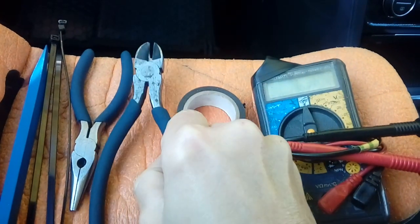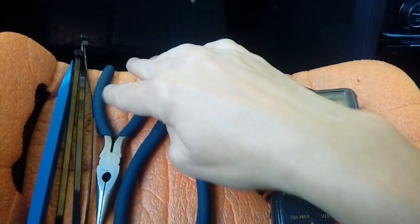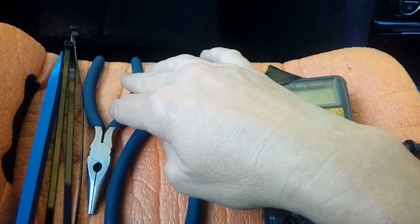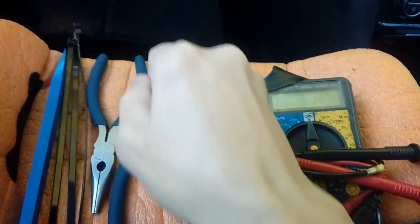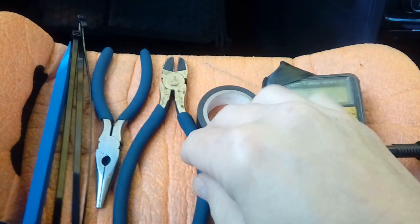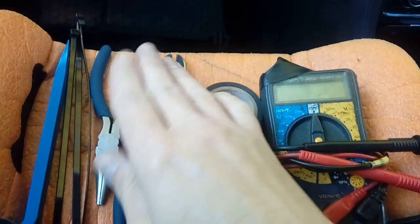Electrical tape, a pair of wire snips, long nose pliers. You don't technically need these — I use them for getting the fuses out of the fuse box. The cars do come with a little plastic thing for pulling the fuse out, but some fuse boxes on certain cars are recessed quite a long way, so long nose pliers are quite handy for that. The Golf's not too bad.